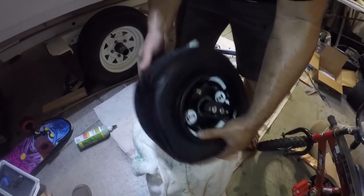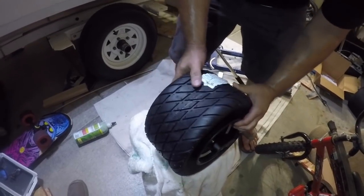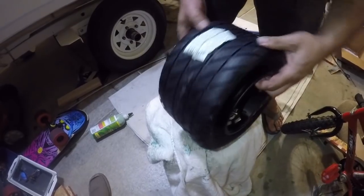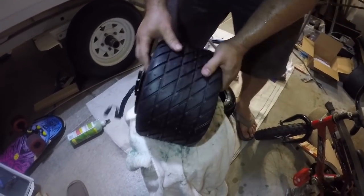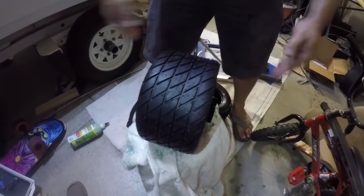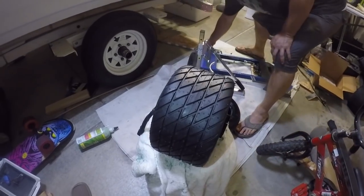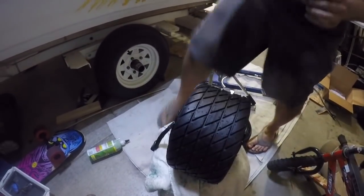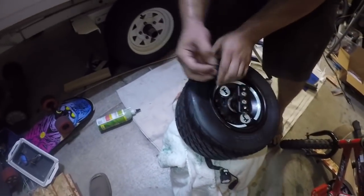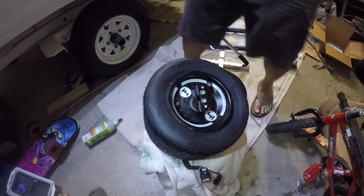Okay, it's in — just kind of straighten out the tire. Come through by the valve there. Looks good — the tire's in. Make sure it's nice — that was both sides, it's both sides! So now we just got to get that little valve back in, air it up, and we're going to re-seat or re-bead the tire — that's what they call it.